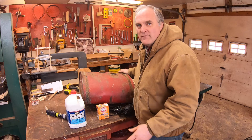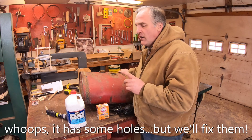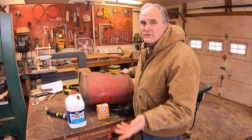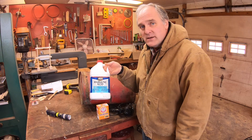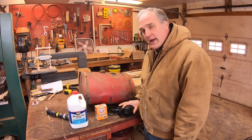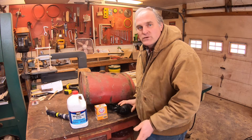I think I've tried every method there is to clean out old fuel tanks. I've tried the etch and coat method where you put in a prep and then coat it with a plastic-based material like red coat — I always worried about that flaking off, and found it didn't really work very well for sealing holes. I tried putting kerosene or diesel fuel in it with some nuts and bolts, tie it to a tractor tire, jack the tractor up, let it run with the tire going to clean it out through abrasive action — that worked okay but it took forever. Then for the last two or three tanks I went to using muriatic acid, which eats rust, and then baking soda to neutralize the acid along with a lot of water, then drying it out with a hair dryer and coating the tank with oil to keep corrosion from starting again.